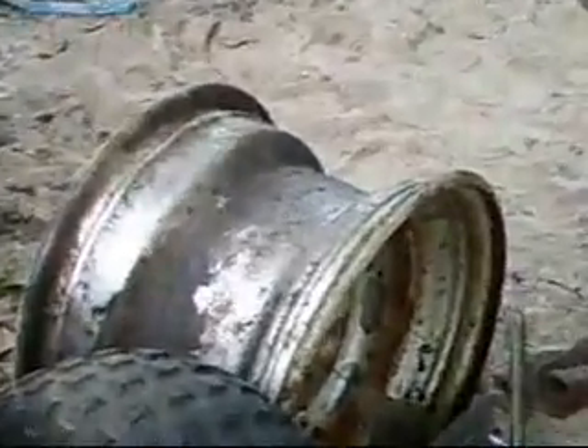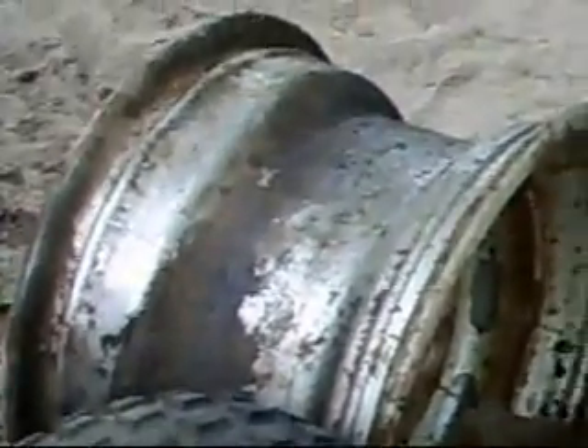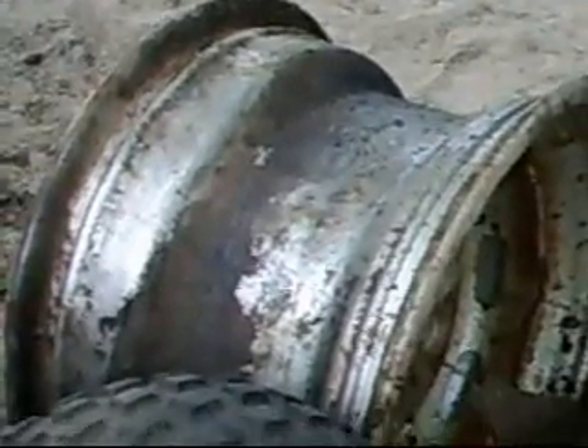Alright. After buffing the area off, put some rubber cement on there. Got both patches in now. Now the only thing left to do is clean up that rusty rim. They're all smoothed out so it's easier to put this tire on. I'll put some more of that clear glide lube on there and put it back together. Hopefully my patch is holding.